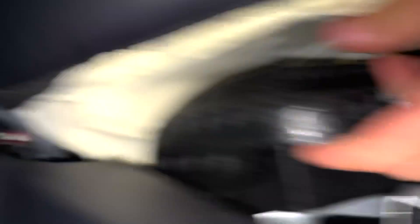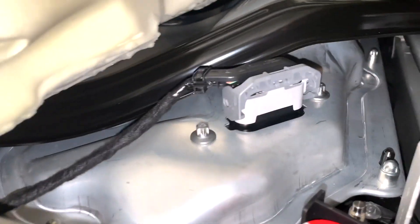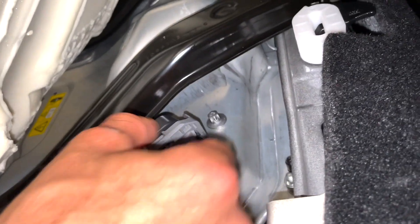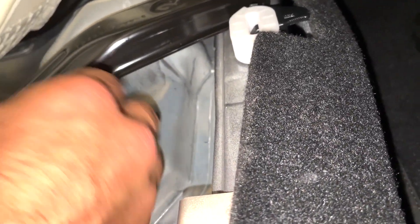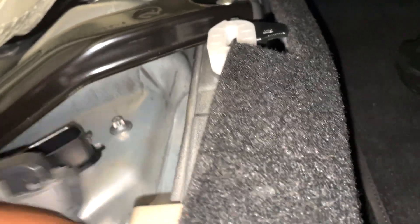As a secondary precaution, there's a tab here you can use to open up the seat. Remove this foam or styrofoam bit, and then there's a little switch. We're going to remove this by pinching in the clip, and then you'll hear the high voltage disconnect. Just take that out.